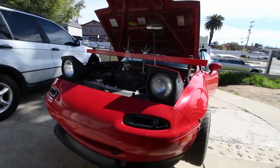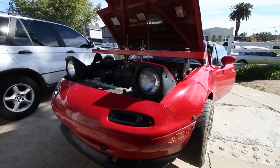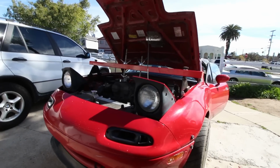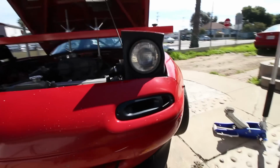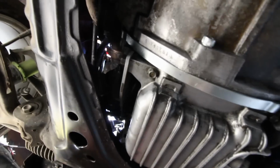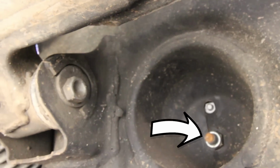I'm not gonna go into super detail on how to change the motor mounts because I already have a video on that, which I'll link in the description. But in a nutshell, you need a way to support the engine, like with one of these engine slings or from underneath with a floor jack. And then once you get under the car, you'll see that the motor mounts are accessible from just behind the front subframe. You got your mounting bolt that hooks up to the subframe.